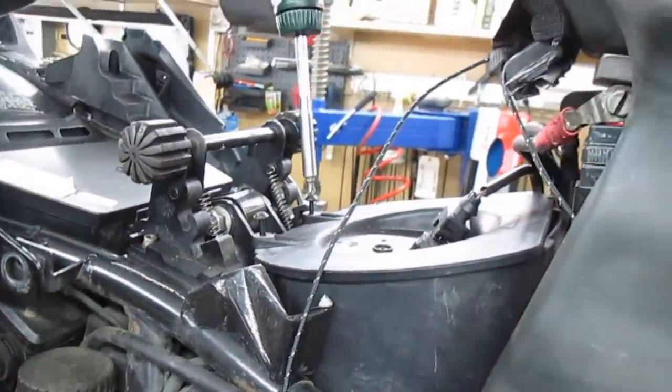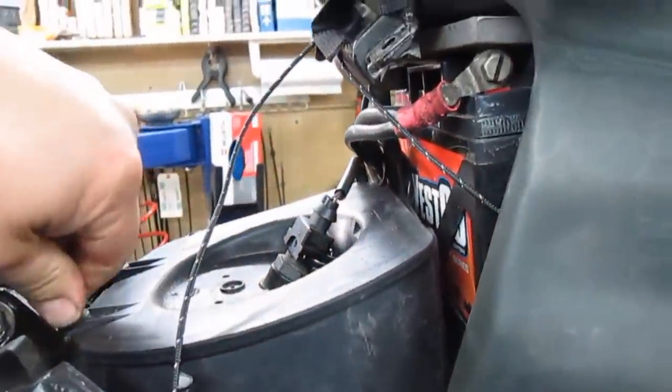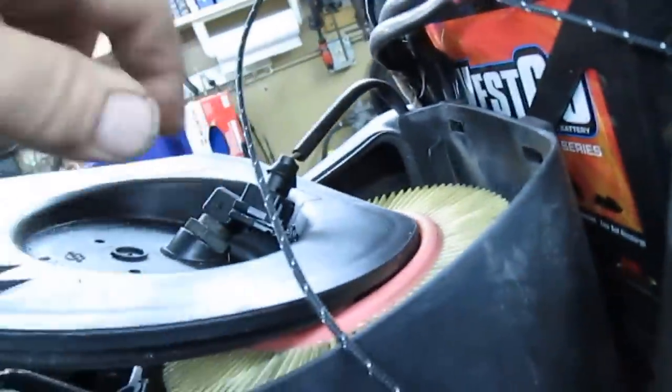Inspect this air filter. Our spark plugs look new, which is good. You'll notice that our air temp sensor is backwards, which was something that started after the car division took over. The bailing wire should be on the back side. They insert the switch backwards.